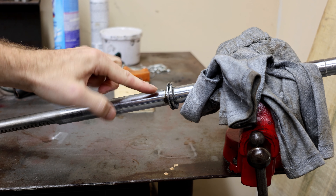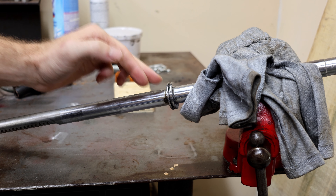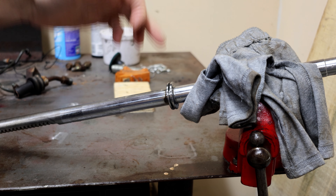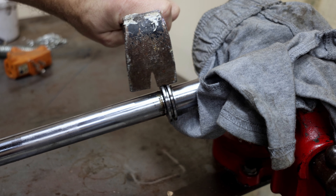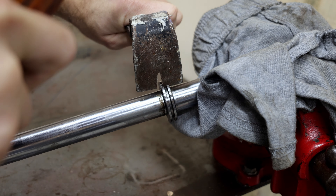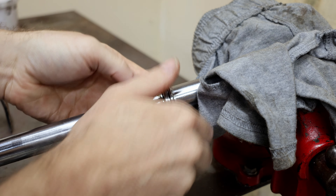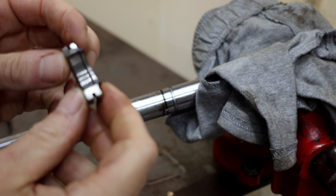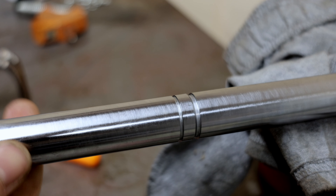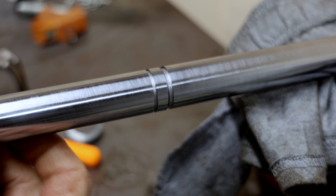Normally on a hardened ring like this, you're going to cut it as much as you can without contacting the shaft, and then you're going to use a steel punch — a chisel point punch — and hit it. It just shot off. You're basically using the material's hardness against itself to crack that little leftover material.